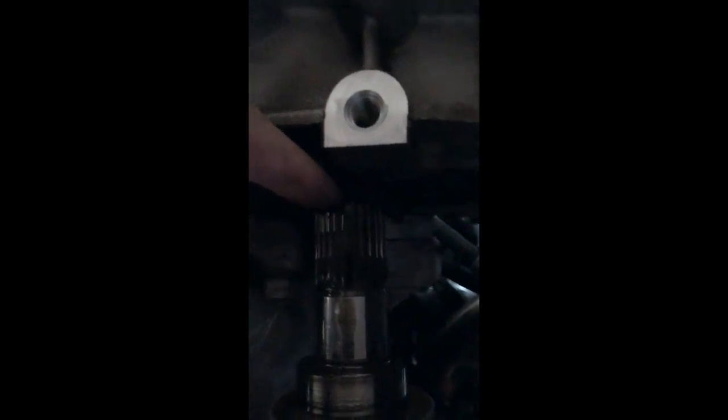So you have to pull those out, and on this side there's the hole for where the axle goes. When you pull these three bolts out and pop this off, then lower this down, it automatically wants to pull this out. This doesn't pop out, it just slides in and out real easy. So we slide it out enough to dismount it from the transmission, and we have enough room to maneuver the transmission now.